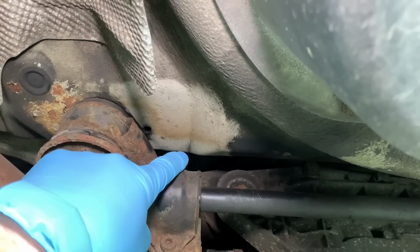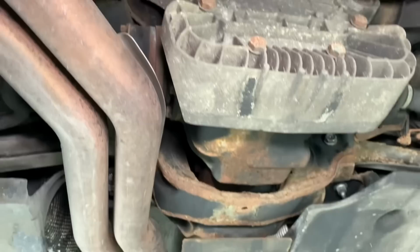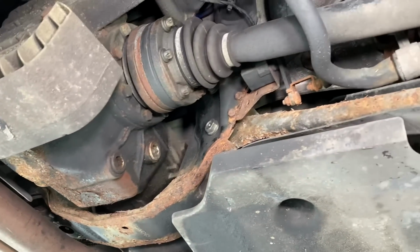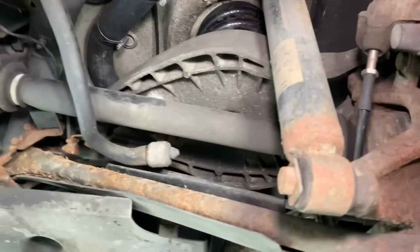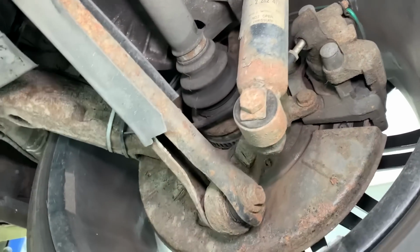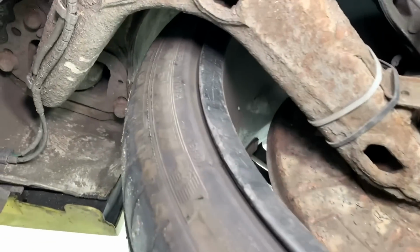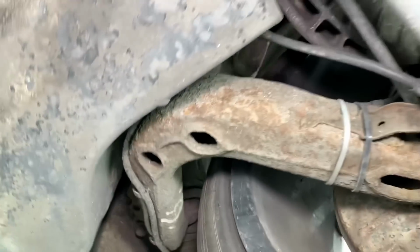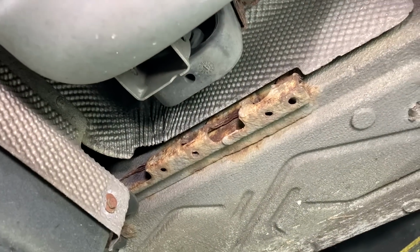There's the typical hairline crack that we noticed on the previous inspection, which we did 10 months ago. And this is just a typical sort of underside nowadays. They don't really escape it. Corrosion is prevalent on all of them. Even on my E46 M3 that I bought, it was like this. Mine had about 73,000 miles on it. It was quite corroded as well. And then obviously I've gone through mine and just done the usual bits, powder coating and the typical sort of things that these cars need. Chassis corrosion on battery boxes and things like that.